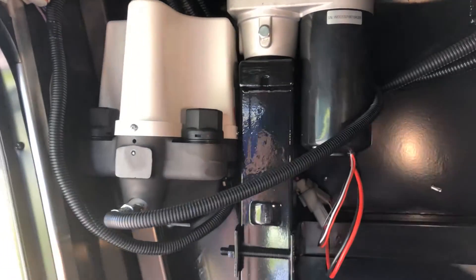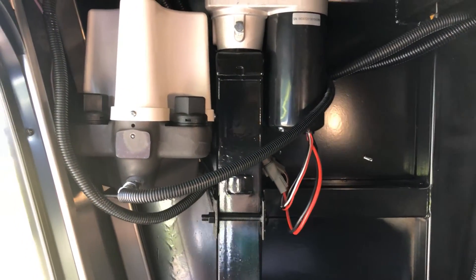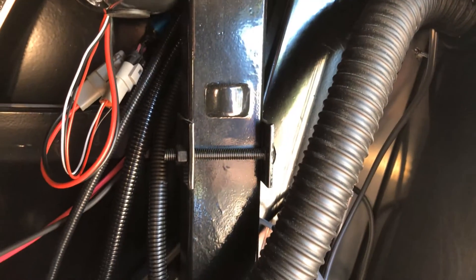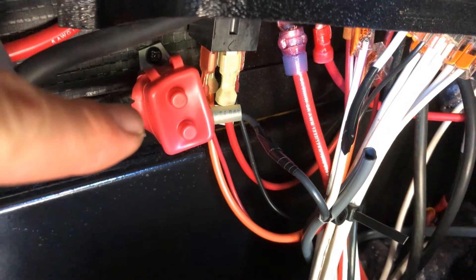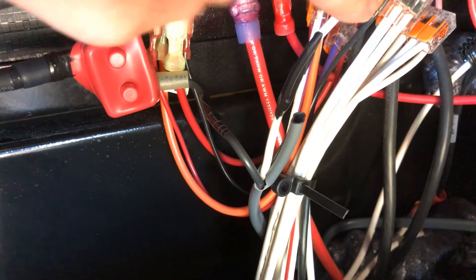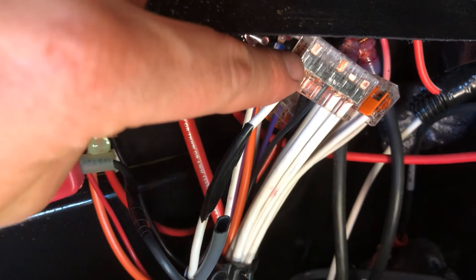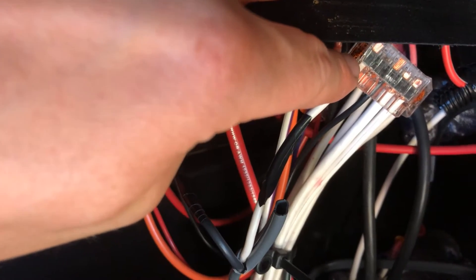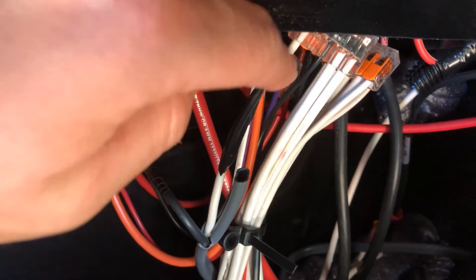My brake unit is mounted on the side — I'm not giving up any storage space or future area for solar or battery arrays. The wires come down and I did run myself a little long on wire but wanted to leave extra just in case. I added a 40-amp circuit for cutoff, teed right off the main 12-volt and ran through that 40-amp breaker. The WAGO connectors are what Grand Design is now using instead of crimp or twist style — super easy to open, close, and change wiring, with an extra slot I took advantage of.